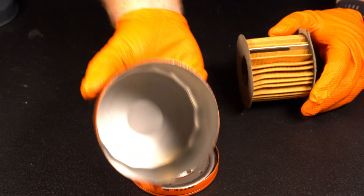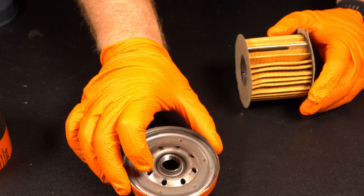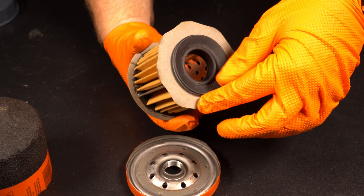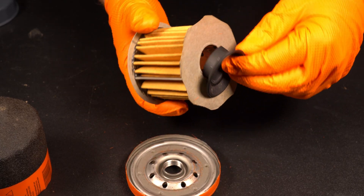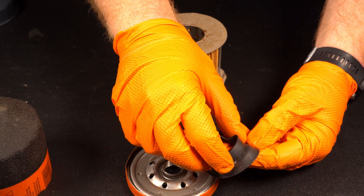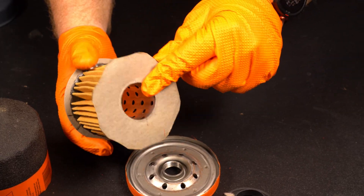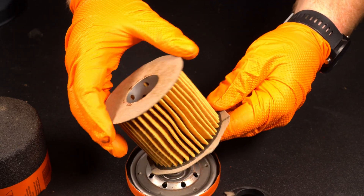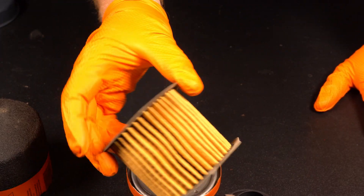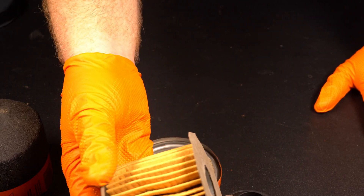It might be galvanized, but it doesn't have that rough galvanized look. That's pretty hefty - most of the weight in an oil filter is this base plate. The anti-drain back valve is tight in there - I think it just had some manufacturing oils on it and it bonded itself to the material. It almost looks like gasket material. This is jokingly referred to as cardboard - it's very close - but cardboard wouldn't withstand being inside. Unless a filter has real high mileage on it, the end caps tend to be all right.